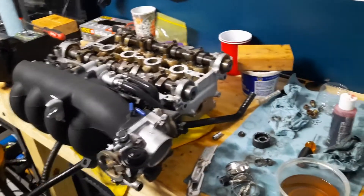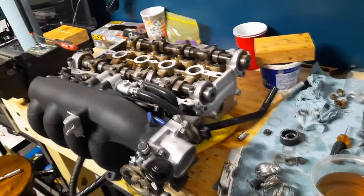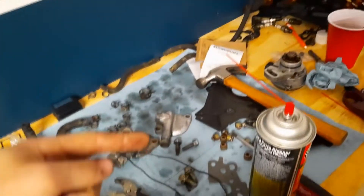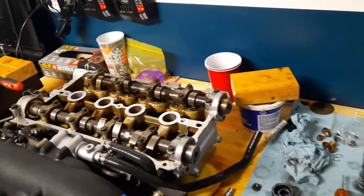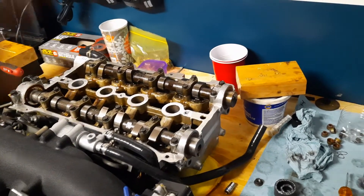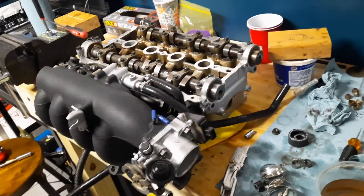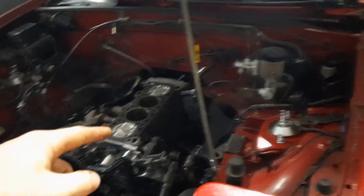It's a new day. After yesterday's clip I realized I had put all the exhaust valves in and forgot the valve stem seals. Had to go buy more — I didn't like the ones I had — but the head is back together now with all new valve stem seals and all new valves, all lapped. Cams are installed, head's fully back together, intake manifold is on. About to throw the head gasket on and then lift it into its home.